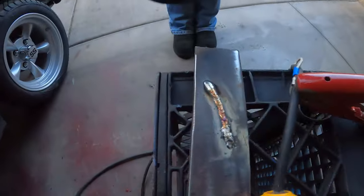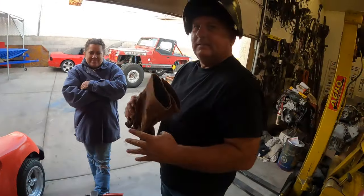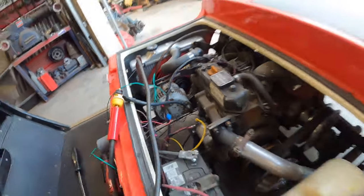Those welds are gorgeous. I can't believe how fast it went. Yeah, they weld pretty good. So basically, you should externally regulate your alternator - that's the easiest way. The diagram talks about a mid-80s Ford alternator; those will fit most Chevys and all Fords. That is the best alternator you can use - the 120 amp. I really like the Nippon Densos that come off from the Dodge diesels. This one off a Jeep is basically a 70 amp alternator. All of those actually work really good. I hope this helps you guys turn your alternator into a welder. Thanks for watching.